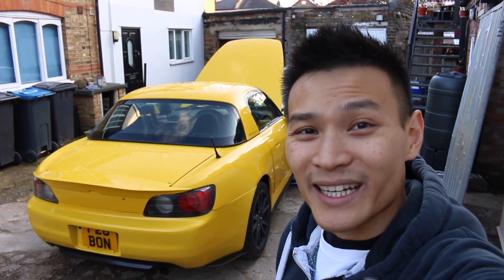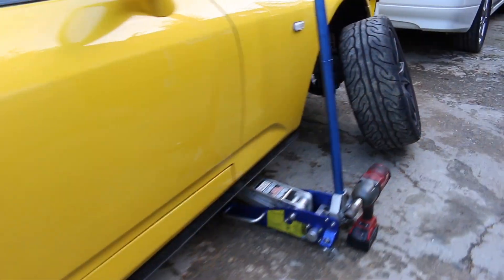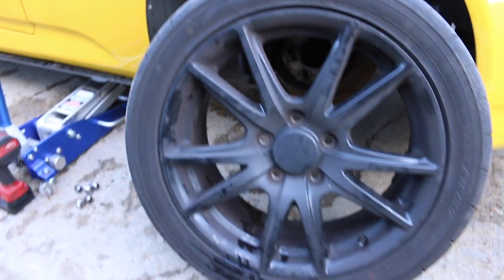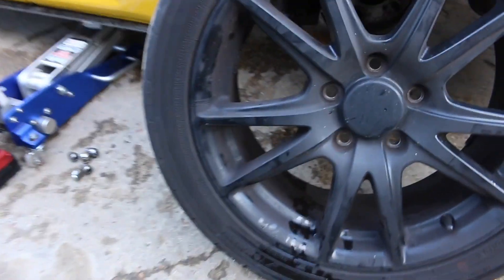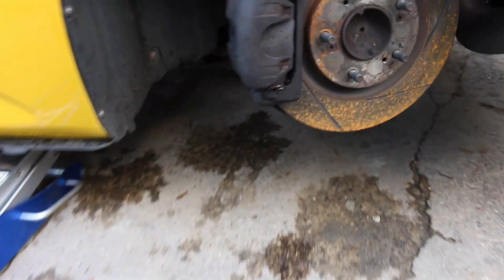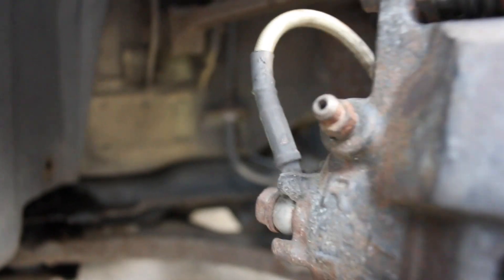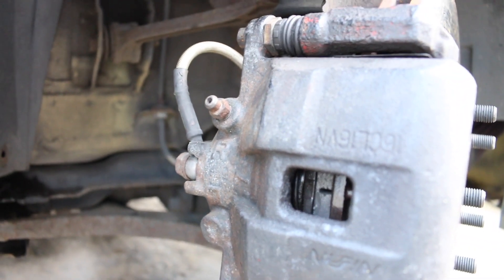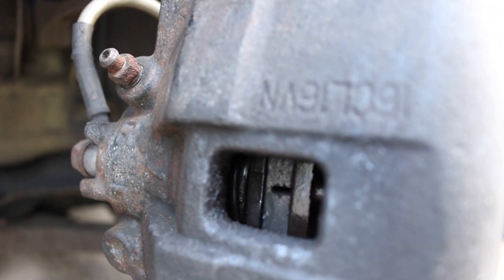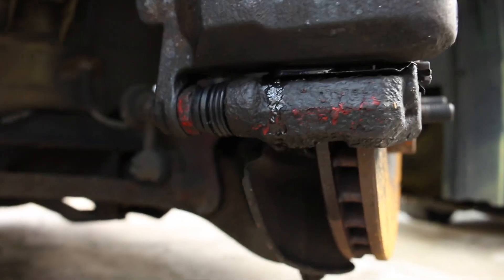I finally gave it a good clean and the wax it deserves, and upon doing that when I came to do the front driver's wheel I noticed something strange. Well, what can you guys see there? Yep, we have a leak at the bottom of this wheel. At first I thought it was just the bleeder bolt coming a bit loose and leaking some fluid, but it's perfectly dry. Then I thought maybe it might be the banjo bolt — no, that's completely dry too. So I was scratching my head a bit thinking what else can it be. And yep, you guessed it — the brake caliper seal has been compromised and it's leaking. You can just about see it leaking down there.